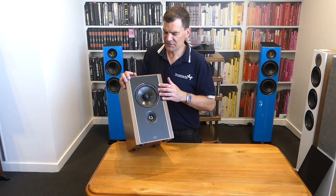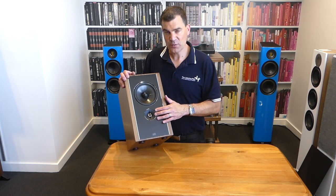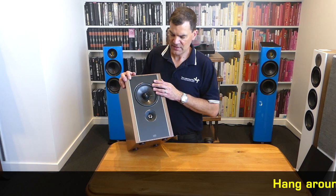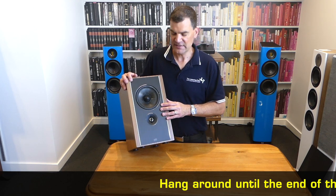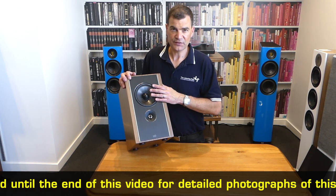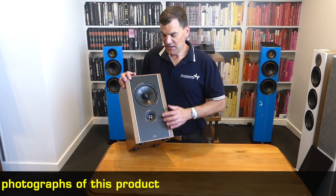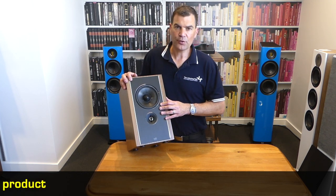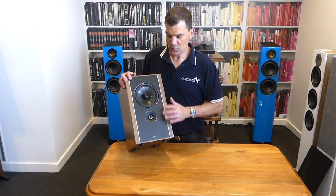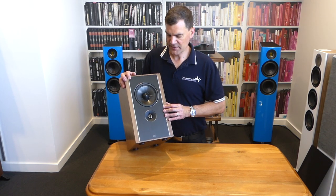You'll see at a glance that the speakers are in an odd location. The tweeter is below the mid-bass driver. Now this is very common with PSB, as they like to ensure that the bass frequencies are less likely to be influenced from the surface beneath them, and the tweeter is more likely to be at an appropriate height for the listening position. So it's wonderful to see that they've continued with that sort of iconic design.